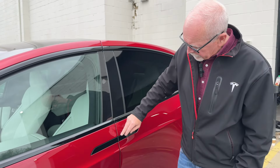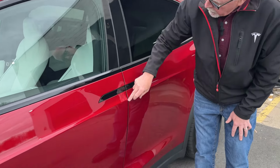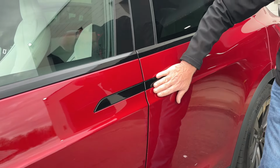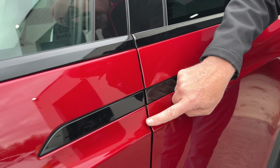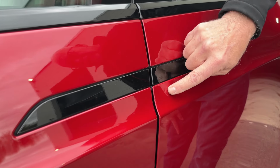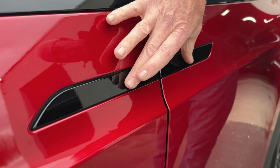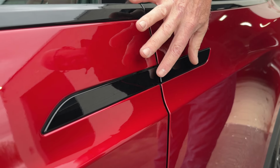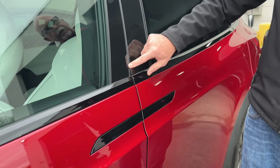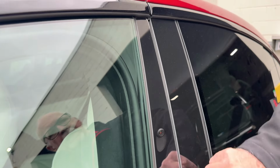If you get this panel right, then you'd have to come forward to the door and say, can I get this panel right? And if I look here, I've got a pretty consistent gap all the way up through. I also have a pretty consistent flush from panel to panel. Here's a good clue on an Ultra Red X: boy, do these door handles line up. There's also adjustments, by the way, for gap, flush and fitment of door handles inside here. If I take a look up further, I start to see some funky panel gaps here, very tight and wide.